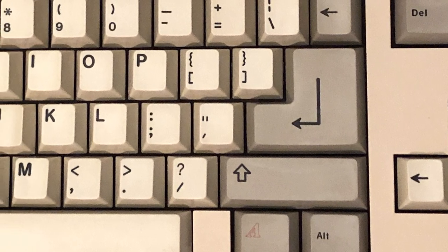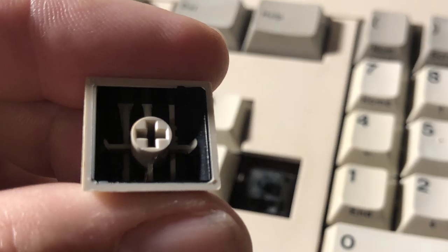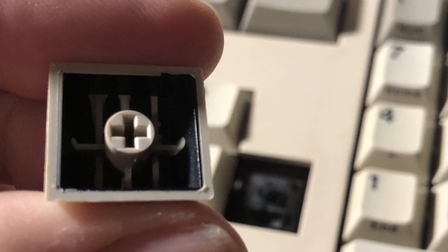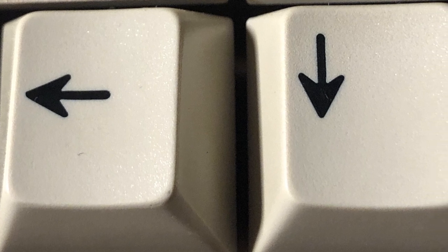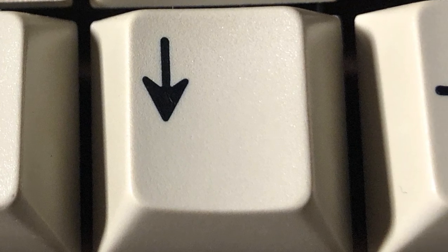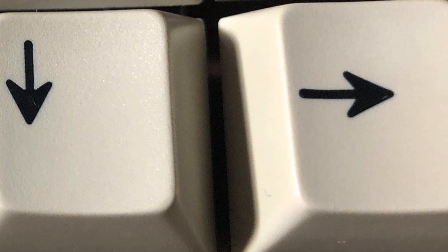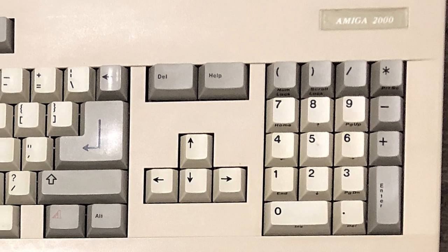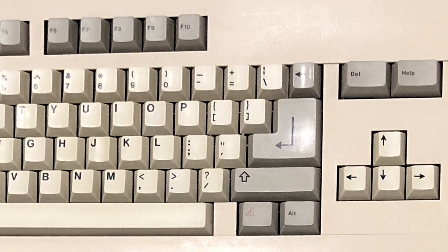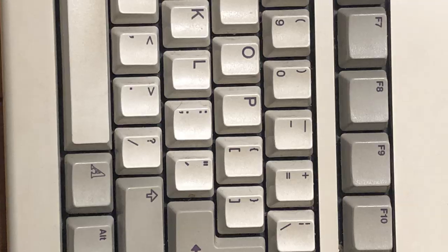The caps lock LED light is a vertical bar of clear plastic at the bottom of the key, not a red dot in one of the top upper corners. The main glyphs and letter forms — also known as the legend — are closer to the Amiga 1000 in style than later revisions. Most of the keycaps appear to be double shot, like the early Commodore 64 bread bin keycaps — made with two different colors of plastic, meaning the glyphs aren't printed on the keycaps, they are the keycaps. The end result is letter forms that should never fade from use, and at worst might yellow a little bit. The keyboard case also has a subtle almond color rather than the typical beige, and the number made is believed to be quite low.